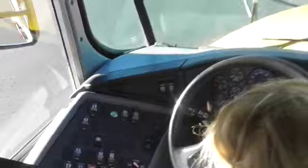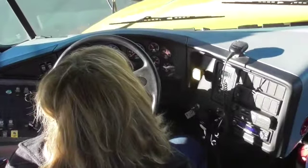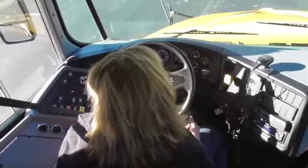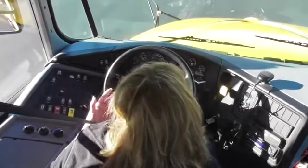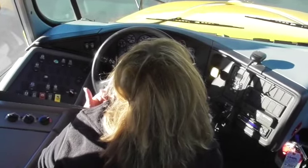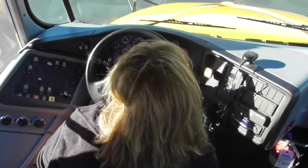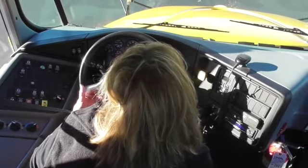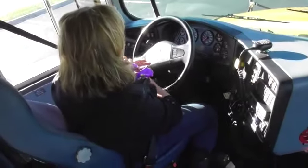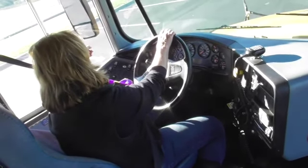Scanning across, it would appear that I have finished my cockpit. I have a couple more tests. I would send the State Trooper out to check all of my lights and go through a complete light system, allowing him to acknowledge that all my lights are working properly. I would need to do headlights, bright lights, my yellows and reds for my eight-way system, left and right turn signals as well as hazards in the front. In the rear I would do tail lights, brake lights, four-way hazards, reverse lights, and all my loading and unloading lights, being sure that he acknowledges each of them — the front in person and the rear through that mirror right there.